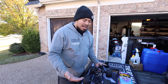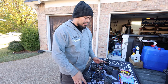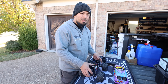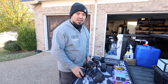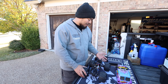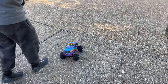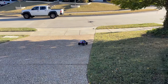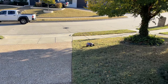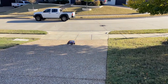Something really weird happened - we went up into the tall grass and it cut out like it was on low voltage. It was strange. I didn't charge this battery with the USB charger - I charged it with a normal charger because mine can do lithium-ion batteries. Maybe I charged it too fast and it false-peaked. So we're going to try running it again on the stock battery. I just turned it off and on and it has its pep again, but then it did the cutoff thing again - look how slow it goes at full pin. There's definitely something wrong. I think I false-peaked the battery.